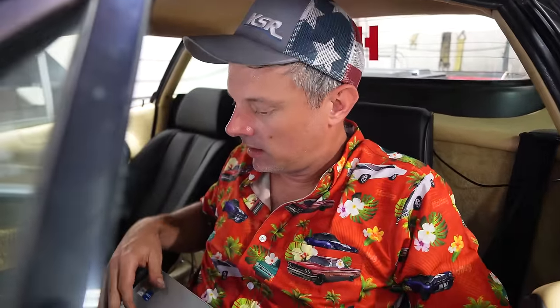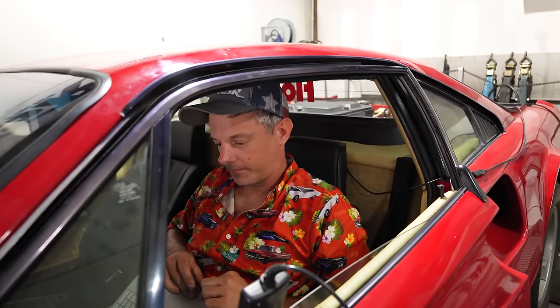Yeah, I'm going to lean it out a little bit, because a lot of times smaller engines don't like being lean or don't like being rich. And we've got sequential fuel injection now and individual coils, so the cylinders should be fairly equal, and the individual throttle bodies. So I'm going to try leaning it out to closer to 13-1 on the Holley air fuel, and we'll see what it is. No matter what, we look fantastic.